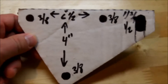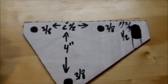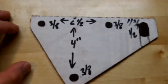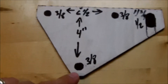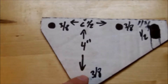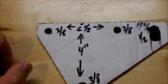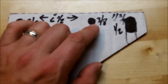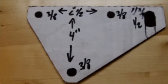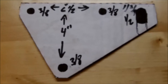Here is the cardboard engine plate mock-up for the 56 Cadillac LT1, so you can see how the angles were done off the car. It ended up being four inches wide and six and a half inches long. There are three engine mount bolt holes and a half-inch elongated hole for the biscuit mount so it can slide back and forth. The offset was one and three-quarter inches from center to center, which gives the right spacing for the engine to sit correctly and still have distributor clearance.